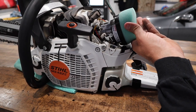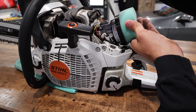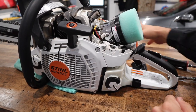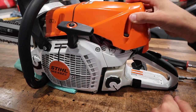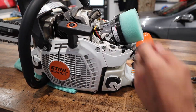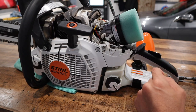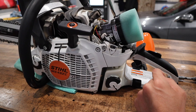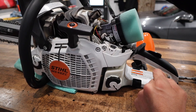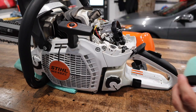It just slips around the same flange that your air filter was on before, and then just tighten it down with the screwdriver. The band clamp is like any other worm band clamp. Uni filters make some awesome products. Slip your cover back on. I'm going to go ahead and uninstall and oil it, and then put it back on — I just wanted to do that for instructional purposes. I'm going to oil this filter up and then we're going to take it outside to show you exactly how much dust it collects.